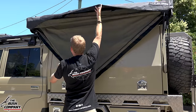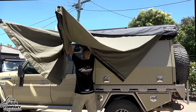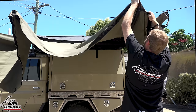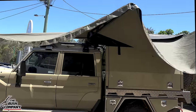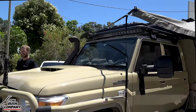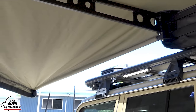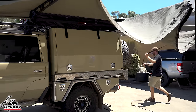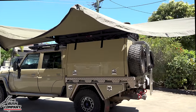Slide this out — you've got two straps, drop that strap, drop the second strap, and it folds out. Then swing this open, just like on our 270 XT Max Awning, and grab the rear arm and pull it to the back. Once it's free hanging like that, go and do up the front — open it and lock it into place. Adjust so it's sitting dead straight, level with the side of the car. Come around the back, grab your strap from the rear, pull it all the way out, clip it into place, and take up the tensioning.